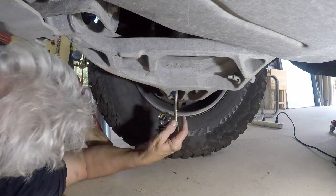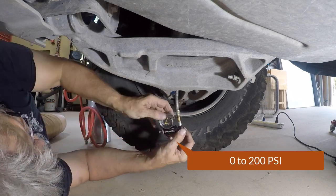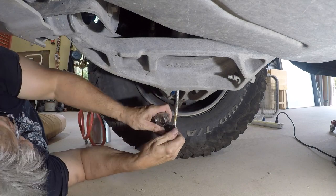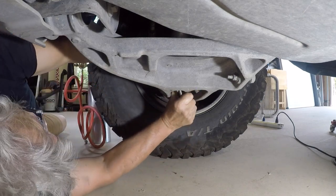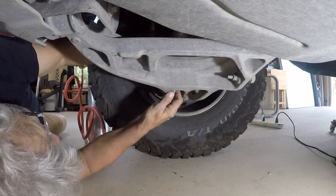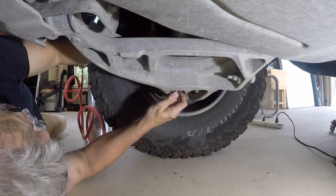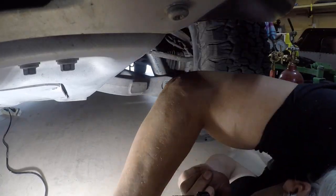You can tell that I go from zero pressure right here to 200 psi in just that short of time. Then it's just disconnecting everything and moving over to the driver's side, which is much simpler because the Schrader valve points to the outside. I can basically screw the no-loss valve right onto that Schrader valve. It works really, really well.